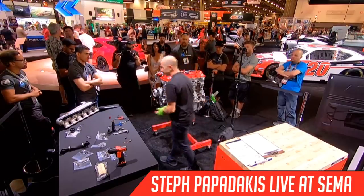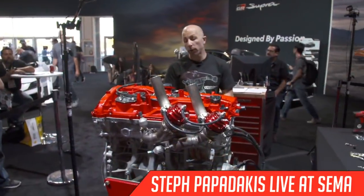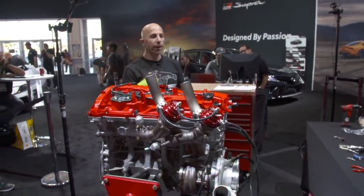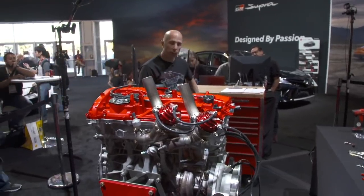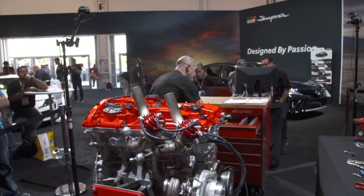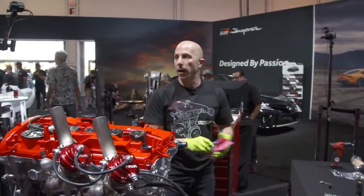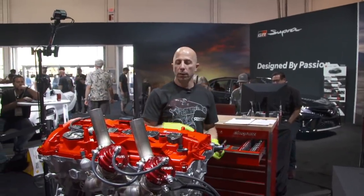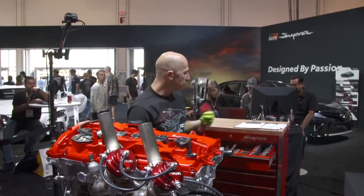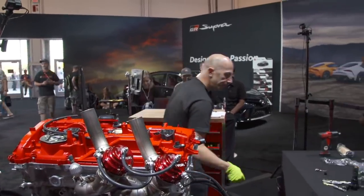Are you guys logging that with the ECU? We logged that with the AEM Infinity ECU, and actually with that data and exhaust back pressure and a few other things, we can give that information back to the turbocharger manufacturers, and they like that because they can start to see potentially maybe we need a different turbocharger sizing or optimize the exhaust turbine housing sizes. So there's a lot of stuff that you can do with that data, or the engineers can do, and we can go both ways and maximize the setup that we're running.